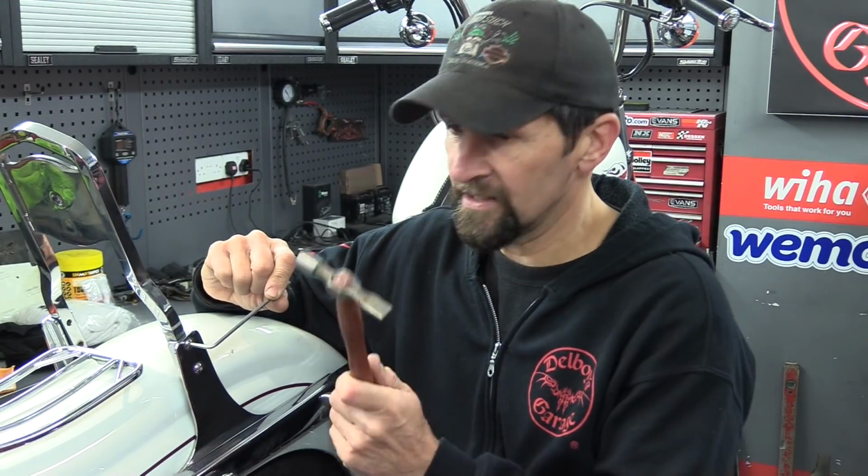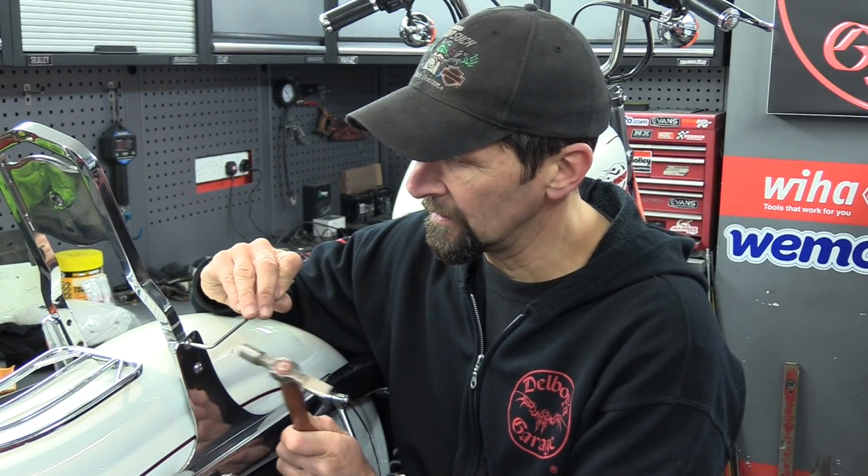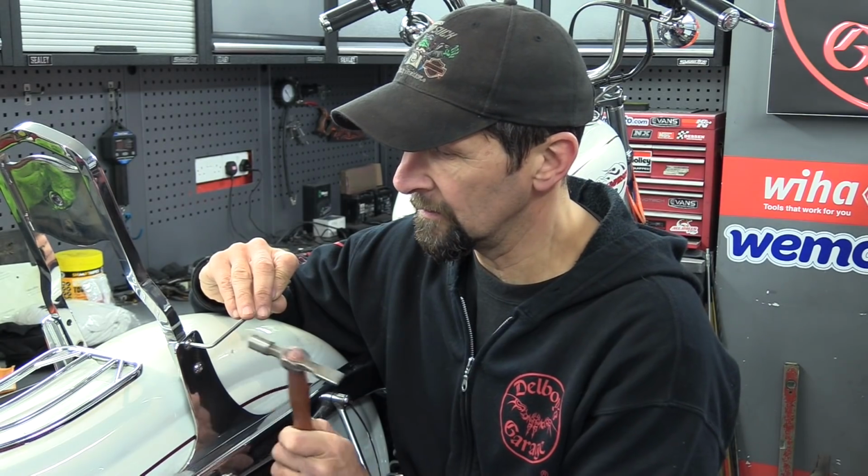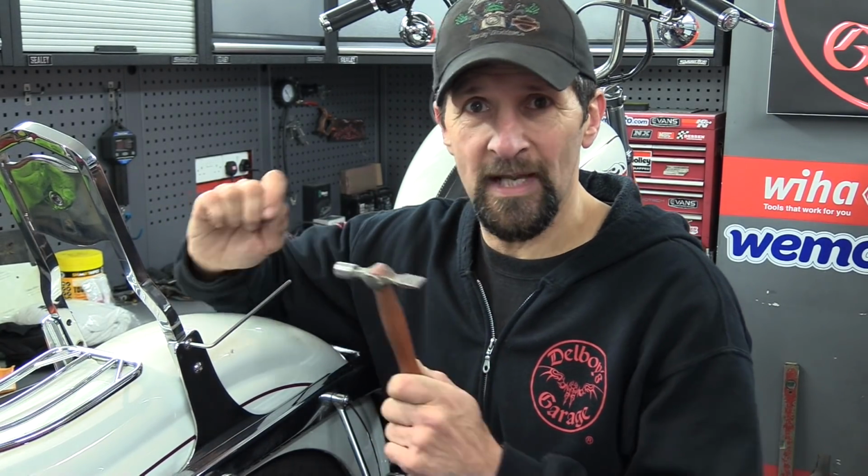So a little trick for you is get a little toffee hammer and just tap it in. It will go all the way in and you'll feel when it touches base, because it will go solid and be more of a hard metallic ping. There it is. And then all you need to do, use it like an impact driver so you don't mince this head out and then have to remedy it by drilling it out or center punching it or something.